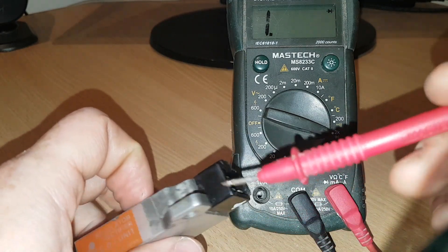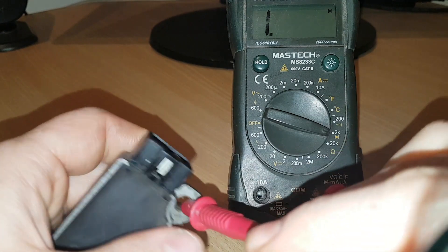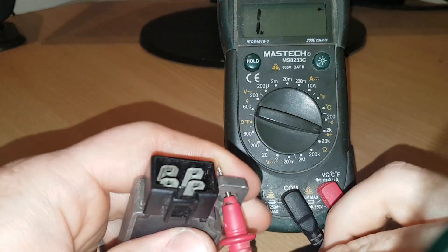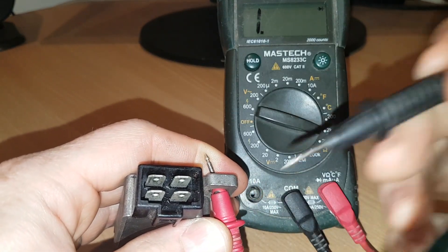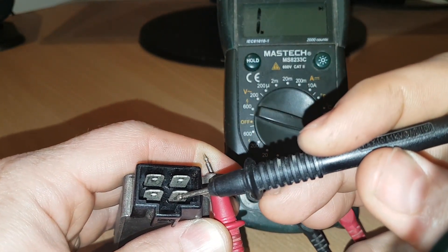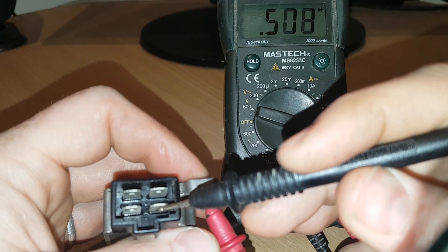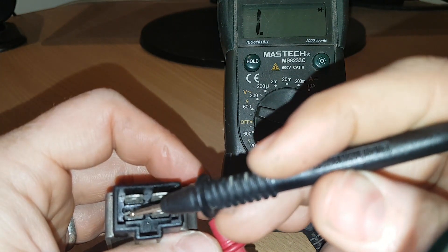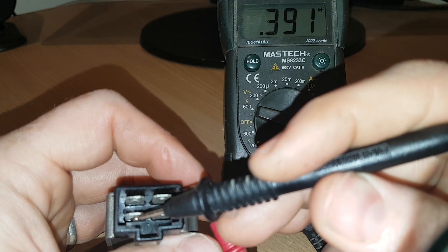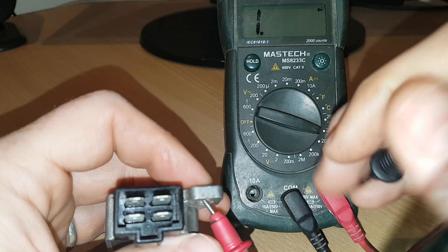That's pretty much the offline test. What we can do now is test the earthing circuit — the earth diode board. We'll just do a reverse bias here. Chuck that on here just like that, touch the three phases and we'll get some readings again. Consistent again.